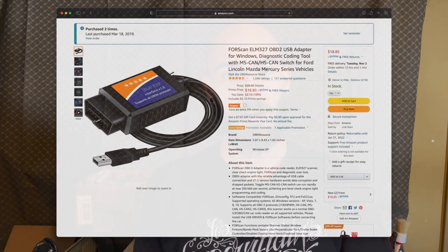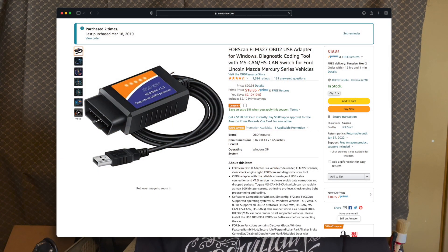Next, onto the parts that you don't have laying around. You're going to need a $20 ELM327 clone device. There are many of these clone devices online that come prepackaged with USB and OBD at the end. You could also buy the chip by yourself if you wanted to solder up the RX and TX lines to your Arduino, but I'm just going to get the cheap USB version. There are Bluetooth versions too, but in my experience they don't work well — they're missing features and have pins that are there but not wired. So we'll just stick with the USB ones. I'll link the one I bought down below in the description.